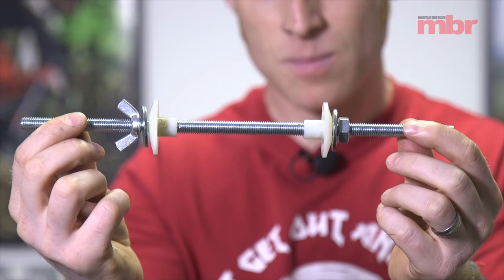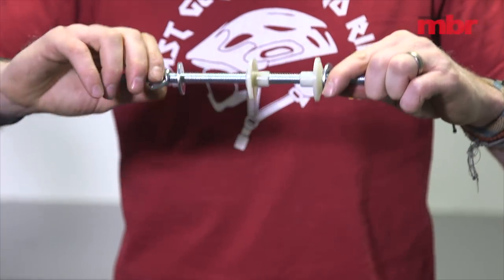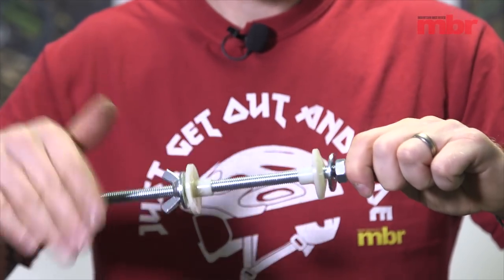One of the tools that's really useful but costs a lot is a decent bearing press, which you can use for your headsets or bottom brackets to push bearings in properly and neatly. But you can make your own version at home using things from a hardware store. What I've got here is a piece of threaded M10 bar — just a simple steel threaded rod — with a couple of washers, a wingnut, and a nut. The wingnut allows quick manoeuvring, and the nuts tighten up to get everything pushed into place. It's not as perfect as a specific tool, but if you're careful you can use these time and time again.